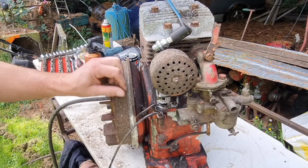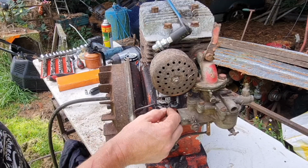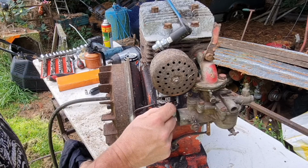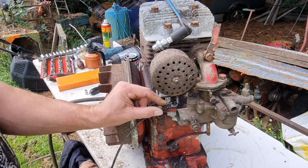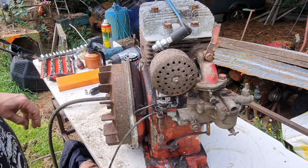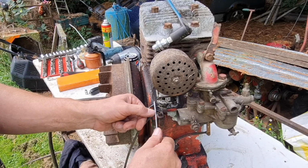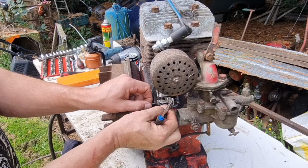I wonder if that wire will... because we've got plenty of wire here. I wonder if we can pull a bit of that through and re-strip it. We can't take too much off our condenser. Do you see what I mean? That's really tilly-willy, that. So we're going to cut that off, and we're going to see if I get a hook tool in here and lift this little thing up, I think we can pull some wire through.